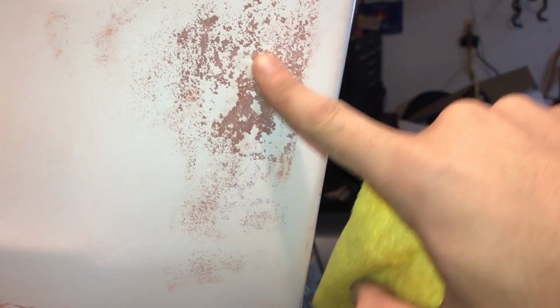One difference when sanding this instead of Bondo is you don't feather it in like you would normally if you're just doing a normal Bondo job. With this stuff, you fill in the little holes and you take off everything that is not in those holes. So as you can see, the hole is filled in, and right next to it is the level surface of how the body is actually going to lay. So just kind of clean it all off.